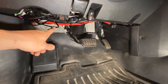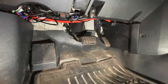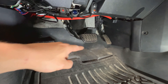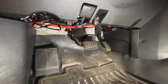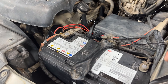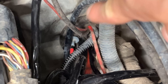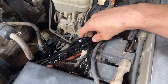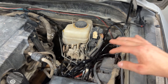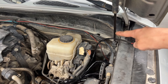Now we have everything tucked away. Cable ties are keeping the main harness up, and this is tucked and attached to the other harness in there. You don't want it touching anything that moves — your feet, either pedal, or even the steering column underneath going to your steering wheel. Make sure it's away from every single moving part. Pretty simple: positive, negative, switch shoved through that grommet, butyl tape applied so no water gets in. I've got a bunch of excess wiring on the harness, so in the next day or two I'll snip and solder to clean that up, and make sure all the zip tie and wire harness work is nicely tucked — very important to keep it away from moving parts out here too, just like under the dash.